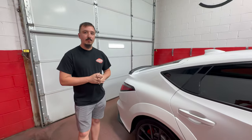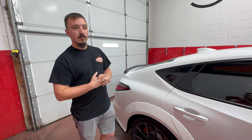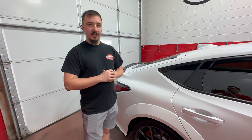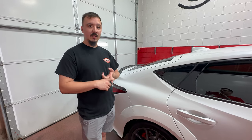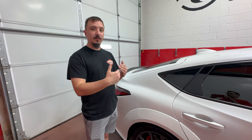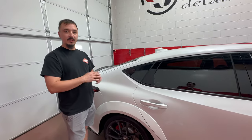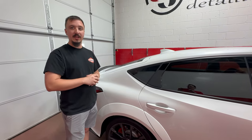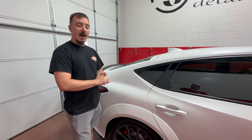And when you roll film like that, instead of doing the whole doors, do you just cut it from your printer at the other bay, or do you have to do it by hand? Is that a more manual process? There's going to be a combination of the two. We do plotter cut, so we'll use our software. XPEL has a program called DAP. We'll modify their kit so that we hide as much as possible. Basically, we're able to roll these edges so that you don't have exposed edges to the film. Obviously, you'll still see a little bit of it because it is white, so the edges do tend to get a little bit dirty. But as long as it's properly maintained, which I'll walk you through as well, we'll hide as much as we can.